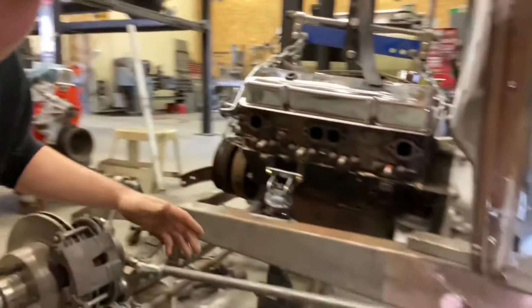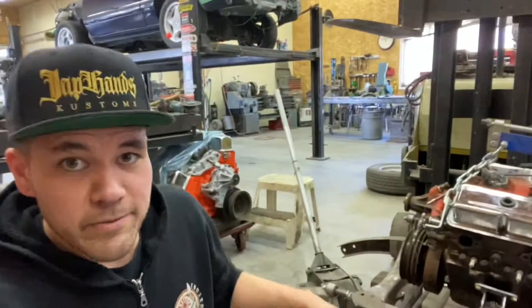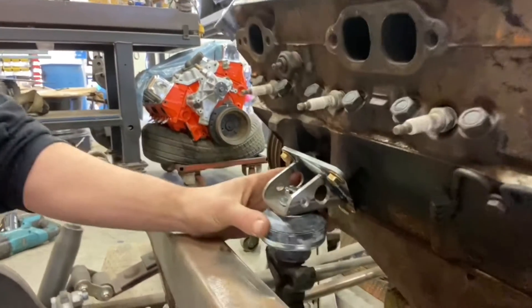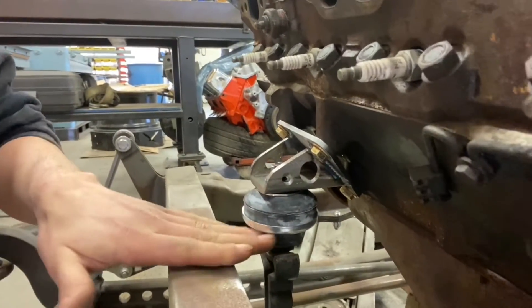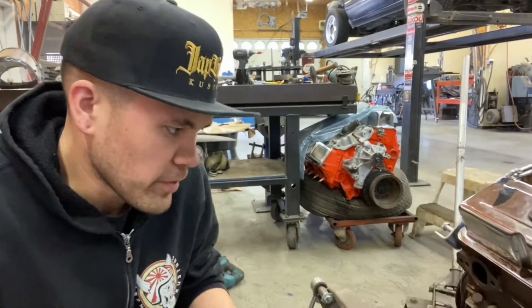This is my second time recording this because I was talking to a phone that was off. Here's the engine placement — we're up a little bit higher than we were. You can see underneath: the transmission pan is basically in line with the bottom of that X-member, which is what we wanted. The oil pan has tons of clearance; nothing is going to hit that. These engine mounts we've made are the donut style — these are replacement flathead Ford ones, not transdapt or anything, actual Ford replacements. They're a nice hollow rubber. The next piece is the pad that's going to hold onto the bottom of this mount, slightly above the frame. I'm going to design it with a couple of holes to make it look somewhat stylish — that's up next.